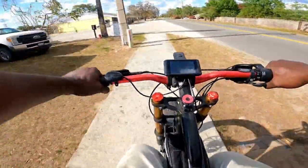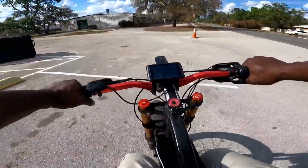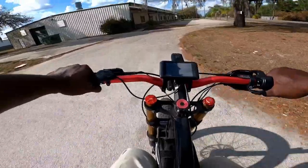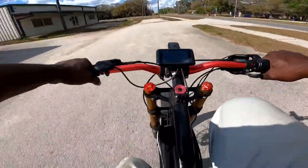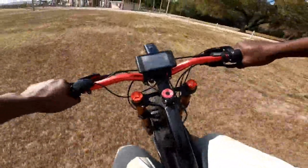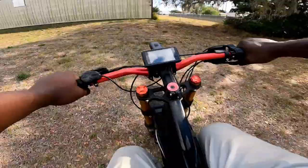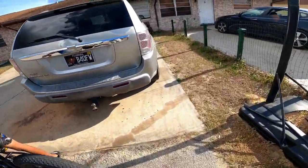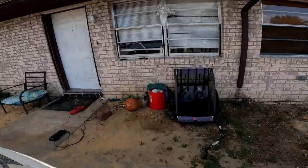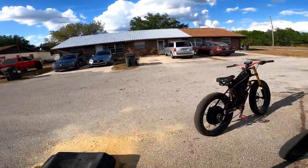Oh my — I've got to be careful! I might end up over the handlebars if I press too hard on the front brakes. I just hope it doesn't come to that where I have to use the brakes that hard to stop. The brakes need to be adjusted just a little bit because they're rubbing — I thought I had it adjusted already but I guess not. I also have a problem with the front having too much brake fluid and it wasn't releasing pressure off the pad.